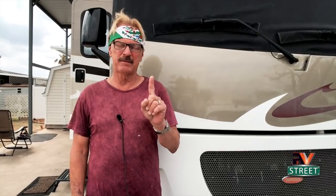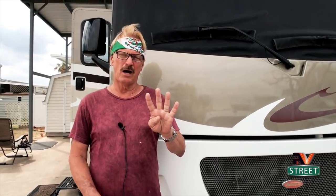In summary, the five things I did to the front are: number one, the cheap handling fix; number two, the front end alignment; number three, the Safe T Plus; number four, new shocks; number five, Sumo Springs. All those things working together in concert have greatly reduced roll going into turns, stabilized the steering, and over rough roads those shocks and Sumo Springs have absorbed a ton of the pounding. Because of these upgrades, I did not need a bigger sway bar up front — I'm still running on the factory sway bar. That's what I've done to the front of the coach.